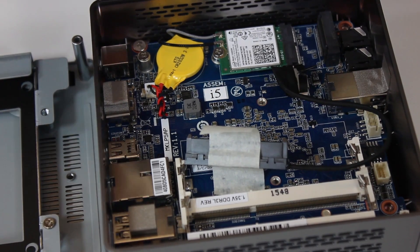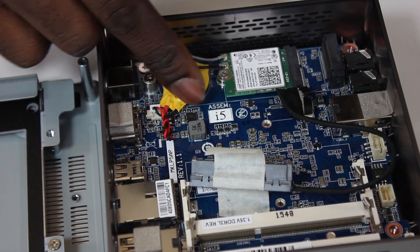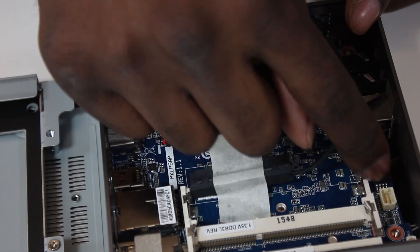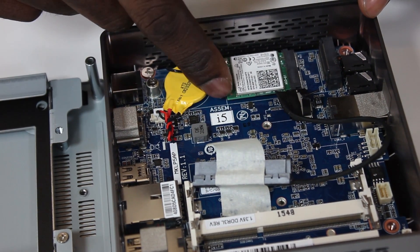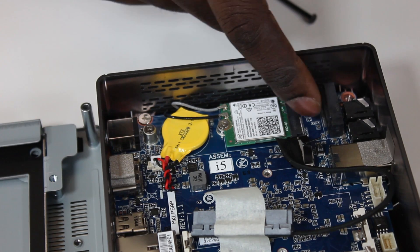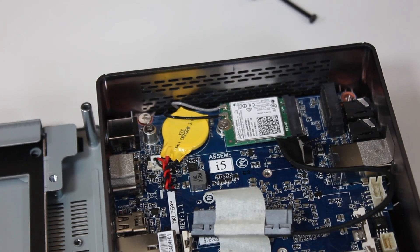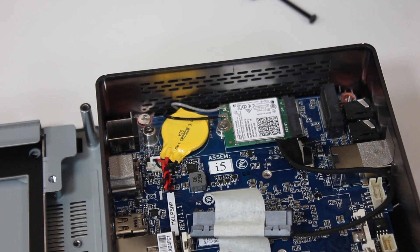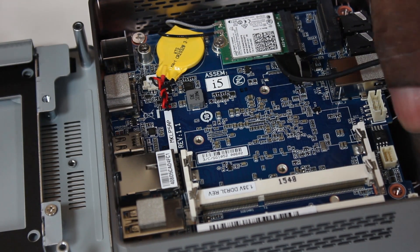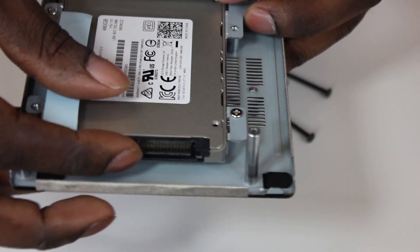Inside it's like a tiny little build — it makes me laugh. There's a little watch battery to remember your BIOS settings, all the chips are there, and it reminds me of miniature USB connectors. You've also got a wireless card here — an Intel chip for Wi-Fi. An M.2 SATA card can go here and you just screw it down over the Wi-Fi card — it'll be fine. This is how simple it is. I'll take off the transport bracket and slide the solid state drive in here.